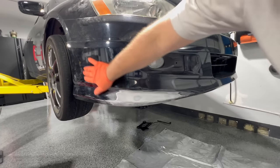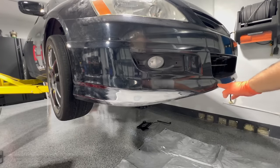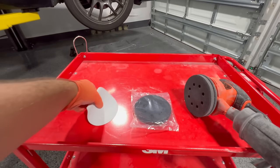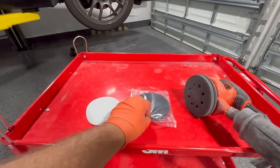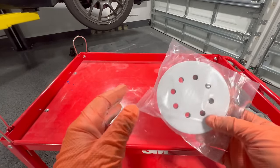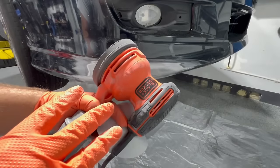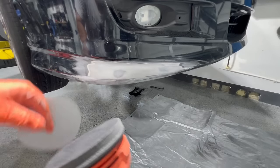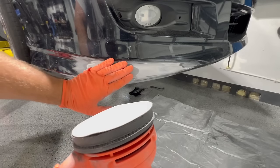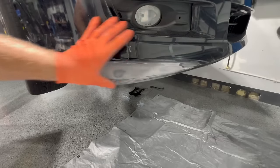Just like that it's ready to go, and we're going to use our 180 here since it's a nice smoother layup and we don't want to remove too much of our UV putty. It's really nice and smooth now. For the next step we're going to go back to our sander with 320 grit this time — make sure you use the interface pad, which helps with contours to give a nice smooth sand scratch. Since it's already been blocked out, we can use the machine sander. With 320 grit being super fine, we don't have to worry about putting any unevenness into the panel.